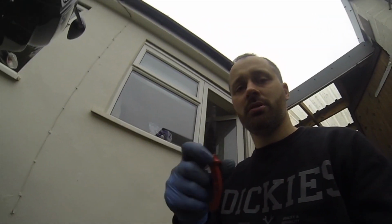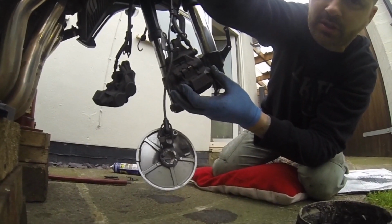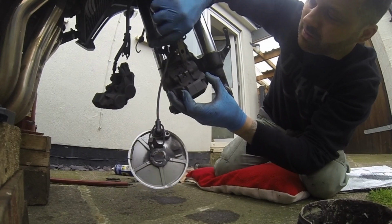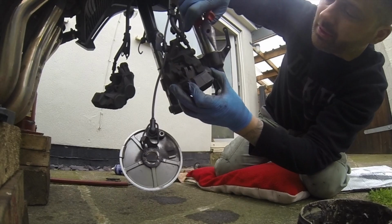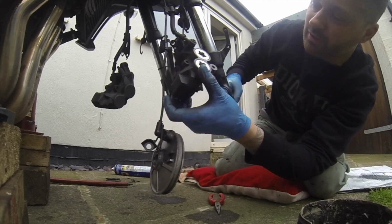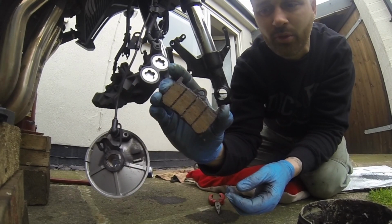It's a very easy, simple job. Pliers, long nose ideally. And what you do is, you've got your caliper, you've got your 2 pins, you can see. Pull them out one at a time, push your securing pin out, and then what that does is release the spring at the back, and then these just fall forward and out like so. That's it. See how badly worn they are.